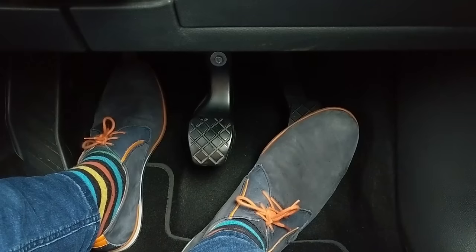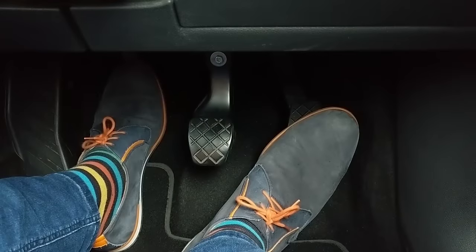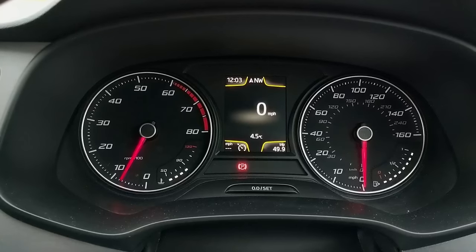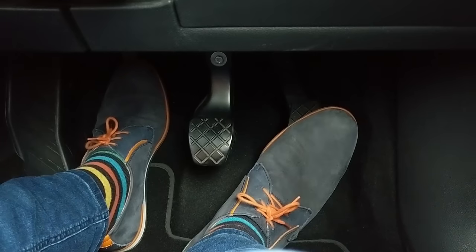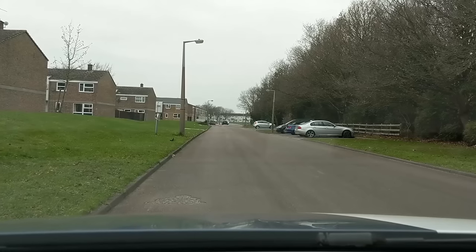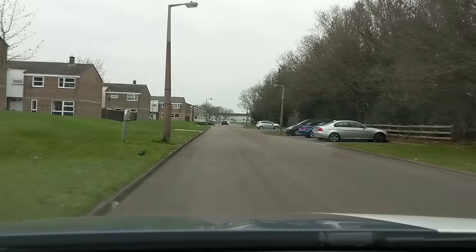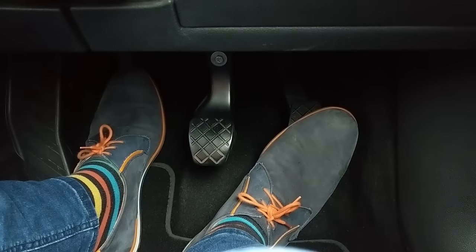Try to keep the gas pedal steady. If you increase the speed above two thousand rpm you are likely to damage the clutch. If the engine speed is below one thousand rpm, the car may stall. Now lift the clutch very slowly until you feel the car start to move. When the car starts to move — eureka! You have found the clutch bite point. When you're at the bite point, keep the clutch still without lifting it any higher — if you lift it higher the car may stall or kangaroo.